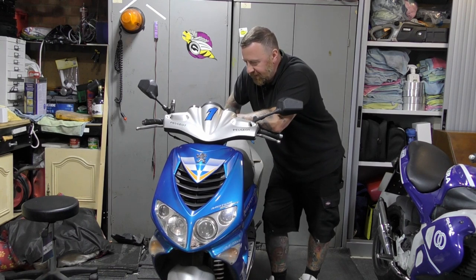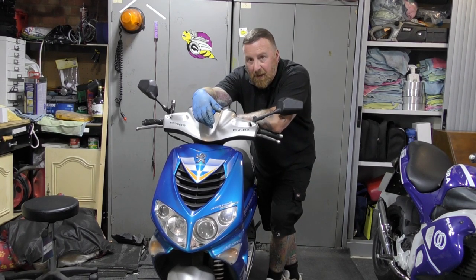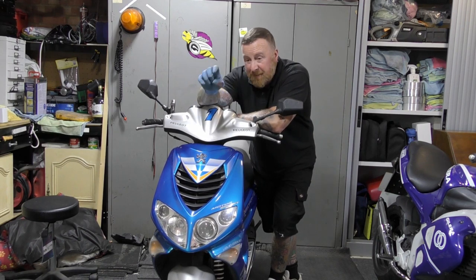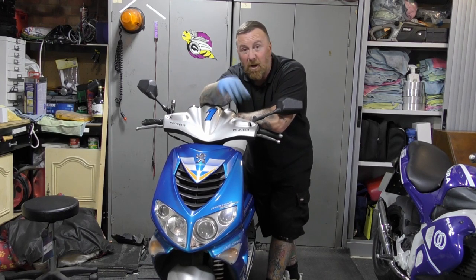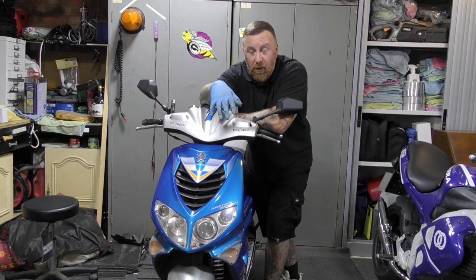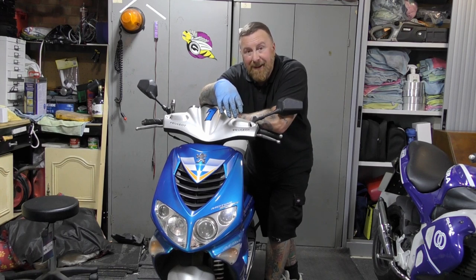Doesn't sound right — look, someone WD-40'd it. I've cleaned all that up. Eight grams — I think it's quite heavy. Knowing the 50cc engine's got a little bit more torque it may be okay, we'll have to see. Belt in there, I've cleaned all the WD that was around. I'm not moaning at the garage — but that shock may be new but not for this bike. They'd also closed in the pin that holds it in so I couldn't get it in, and when I put it back on the other bike it was really rough. It is not rated for a single-arm front suspension — that's my professional view.